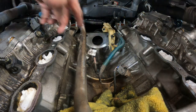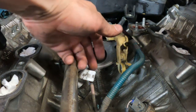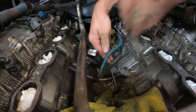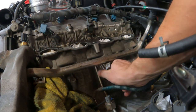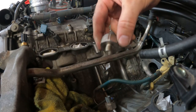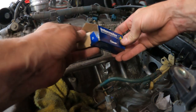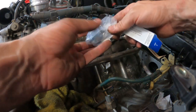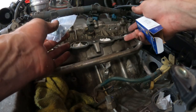It's time to do the knock sensors because if you put the starter in first, it makes it a little more difficult to get this one out. Those are all they are right there — factory, 170,000-plus miles. I only recommend standard motor parts or OEM for knock sensors. You're going to pay a pretty penny for some reason on these, but you don't want to get this wrong and have to go back and do them again. Just get it done right.